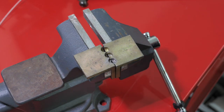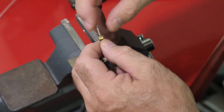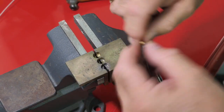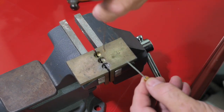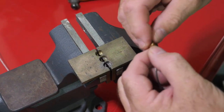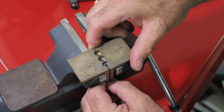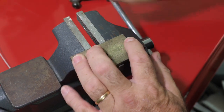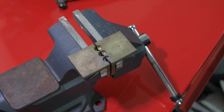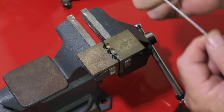I'll do another one for a second example because there is a difference between these two. The second example is using a barrel, which generally goes onto your throttle or into a carb rotor on a side-pull carb. The main difference with using the barrel is the cable has to flex right at the barrel. With the nipple — which generally goes in the top of a carb with a straight pull or into a splitter box — it doesn't matter if you've got a bit of creep in your solder. But with the barrel you've got to be a lot more careful not to get solder creep stiffening up further up the wire. A little bit higher — we set that a bit higher to get a nice larger ball. Quick whack. We've got a nice slightly larger bird's nest sitting in there, and that just sits down on top. Same thing once it's all in place — she's all good to go.